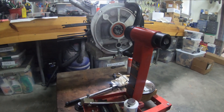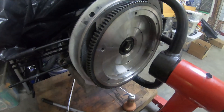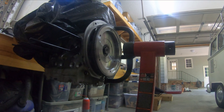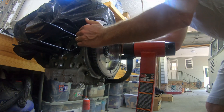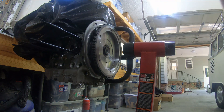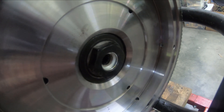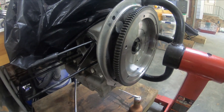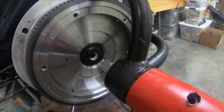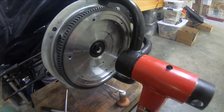I'm going to put the flywheel back on and torque it down. The flywheel is on. Taking a quick look at the end play, there's that same little five-thousandths wiggle back and forth with a tiny clunk. There's the gland nut, and again thanks to that torque multiplier — that is the only way I would have possibly been able to get this back off after bouncing on and breaking a 25-inch breaker bar. All right, it is good to go.